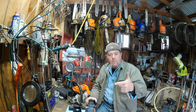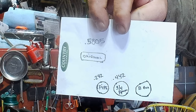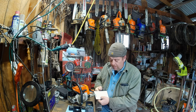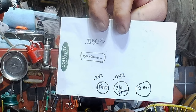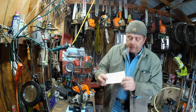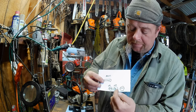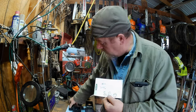I'll get you heat results and horsepower results, and we'll get a dyno chart on these three lids to see where they're all at. I'll try to freeze frame it on the computer for you. This pipe here is 610 thousandths, or about 15.5 millimeters, so that's 0.292 square inches. The three-quarter inch pipe is 0.442 square inches. The bark box is oddly shaped, so it's hard to calculate precisely, but those are all tracings to scale.